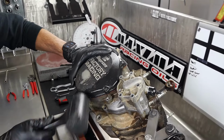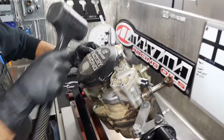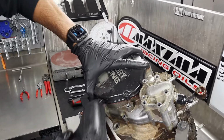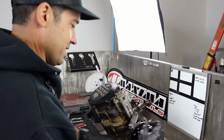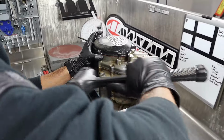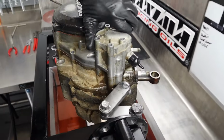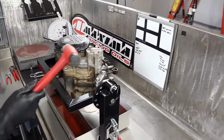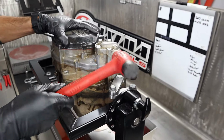What's coming off now? Just the clutch cover here. What else? Pull the primary. These gaskets like to hold as well as seal, that type, because of the paper and the goo. The aftermarket ones are different than the factory O-ring. It's like a big paper one. All these old gaskets, they like to persuade. We're broken down here now, but we've got to break this one. I like the plastic one. A little bit more force. A little whack.